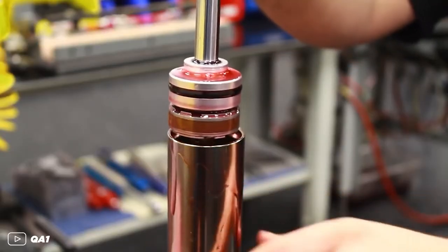The last thing you should look into is serviceability — can you revalve or rebuild these dampers if anything goes wrong? Because it would suck to buy new ones every time something small goes wrong. They're not cheap. If your car is going to be on the track once or twice a year and you spend most of the time on the street, maybe you shouldn't go for a ten thousand dollar set of Moton coilovers with three-way adjustable damping. On the other hand, you don't want to go too cheap either. If all you're looking for is to lower your car as cheap as possible, a nice set of lowering springs on your stock suspension is way better than a cheap set of coilovers. So be realistic with how you want to use the car and your driving ability.